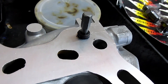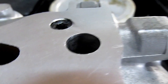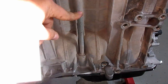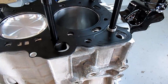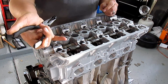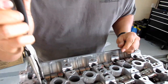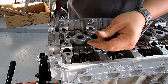Screw this down, make sure it's below the deck and make sure it's tight. Next, take the dowel pins — the exhaust side is the one with the dipstick — put the dowel pin in there and one over here. After you put those dowels in, reinstall the head. Make sure you put the ARP grease on your nuts, then put them all on.